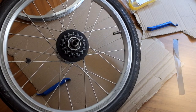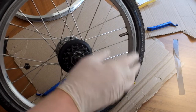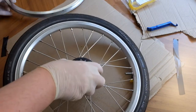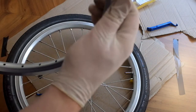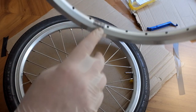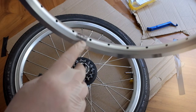I'm going to take some photos and then basically take the tire and the inner tube off and undo all of these spokes, just so we can get the hub, which we're going to put into the new rim, which I've got here. This is a standard newer type rim — it's got a blue circle which indicates it's for the rear wheel.